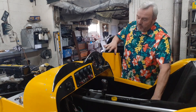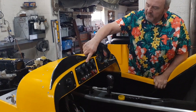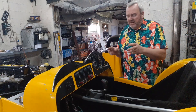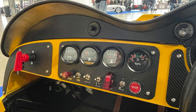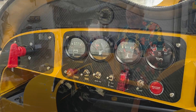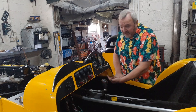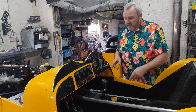You'll see it's all made in separate panels — one for the battery isolator, one for the secondary instruments, one for the main instruments. This was all about the thought for motorsport: if something goes wrong, you need to get easy access in here and be able to take stuff apart in the pits without having to crawl upside down and try to get your head up underneath. So this is all very much considered, and why we did it in three separate panels.